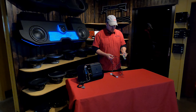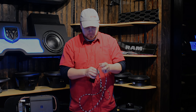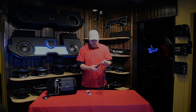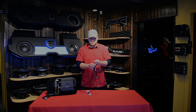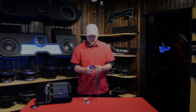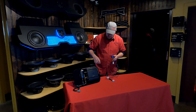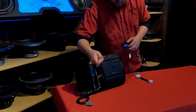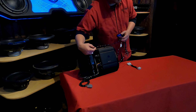This is going to get you the subwoofer signal you need for adding a subwoofer to your new truck — it's that simple. That signal goes to our converter. The other half is a big Y harness with your power, ground, and remote. Yellow is power, black is ground. When this converter sees audio and power, it will create the remote turn-on for you, telling your new amplifier to turn on. It'll make your RCA signal for your new amp, and you get power and remote all in one bundle. We get our power and ground at the new amplifier connections, so you can get all of them from the same location for a really straightforward installation.